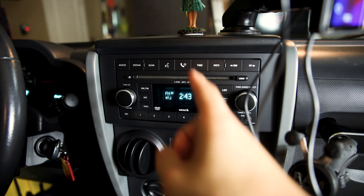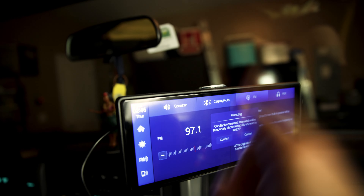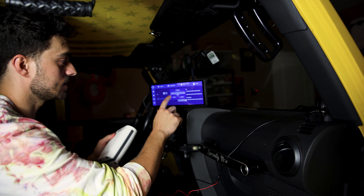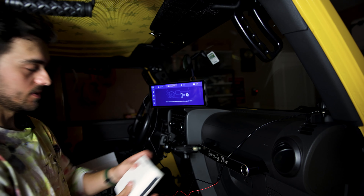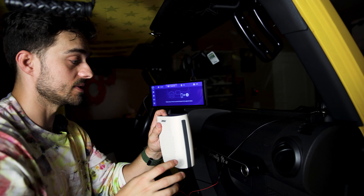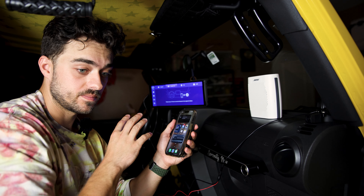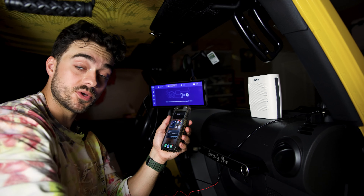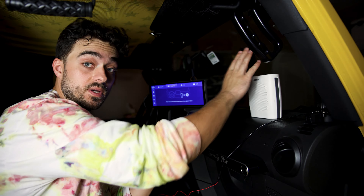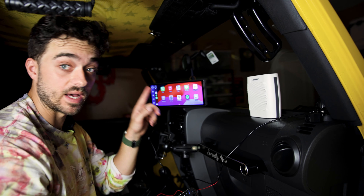This car stereo does not have a Bluetooth connection — you cannot connect anything to Bluetooth directly. However, we do have a way to connect Bluetooth. For demonstration purposes we're just going to use a portable Bluetooth speaker as the original car stereo. You want to connect your phone to the OEM stereo Bluetooth. Go to settings, Bluetooth, and now we're connected to the stereo speaker. We still have Apple CarPlay connected and it's playing on the head unit.